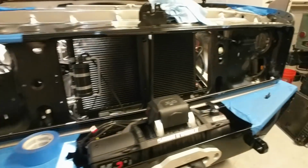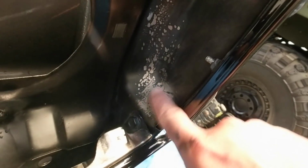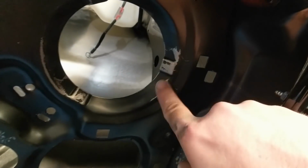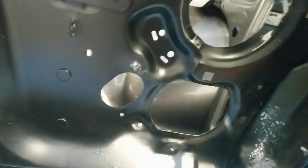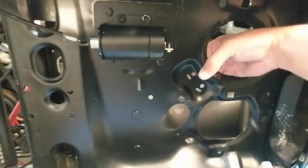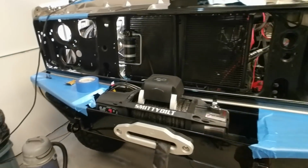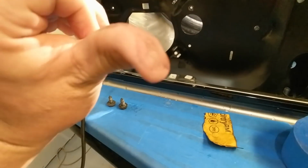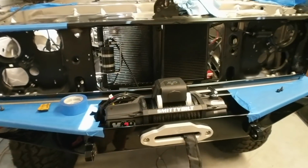and it'll look good because you can see, when I started sanding that with 1000 grit, man, that black was coming off like crazy, and then same with all around these, but man, it is so smooth now. And I'll go through and tape the back of all of this and then just blast this with a satin black to get it all painted. And it's so thin, I'll probably do 2 or 3 coats just to get it done right.